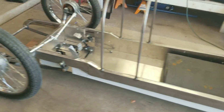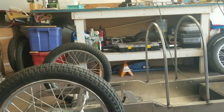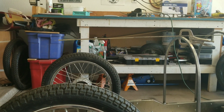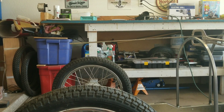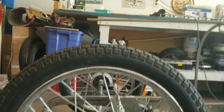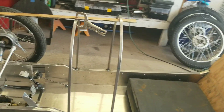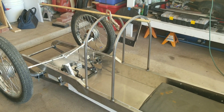I got the front wheels on it — get down low here and you can kind of see where this is going to go. I clamped the yardstick on there so you can see where the hood is going to go. I noticed a little bit of an angle on that — I think that's correctable; I'll angle it up a little bit. The frame is probably at an angle which is why it's doing that, but we'll make sure it matches up. It looks like it's about four or five inches above the tire at the front. Turned out pretty good. Waiting on some parts to proceed on the steering column — that's one thing holding me up right now, so we'll find something else to do in the meantime.